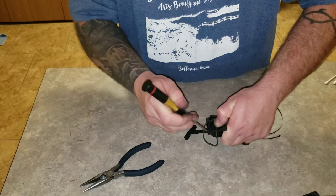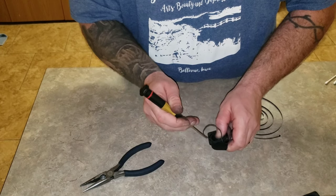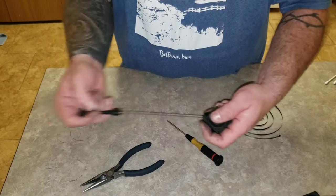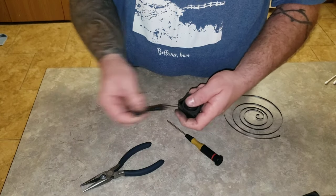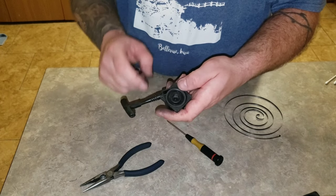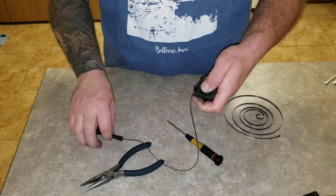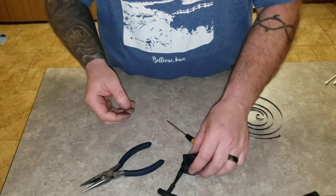Sometimes that string gets in the way of itself and you get confused on which one's which. There may even be another video out there on it, but I figured I'd try to show you as simple and easy a way as possible. The hardest part is getting that hook in there on the spring - figuring out exactly how it's supposed to go. They're all just a little bit different but it's the same process. Once you get it set in the spring, pull it out, pull your string, wrap it, let it go. For all you pull start users, I hope this helped. Thanks for watching.